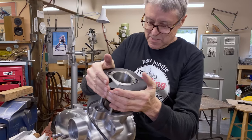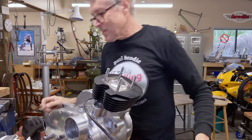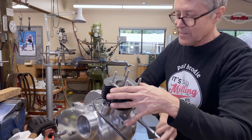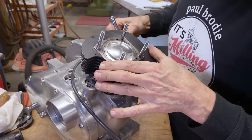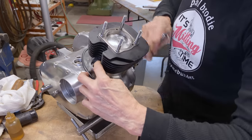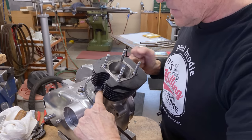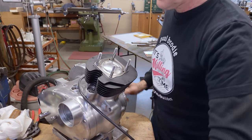Okay, so this is the barrel going on over the piston. There we go — we have a piston going up and down, look at that! Next is cylinder head. So we'll put it on the other stroke where the push rods are both level. There you go — that's compression stroke.